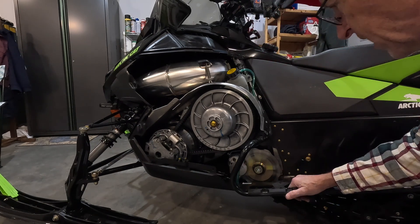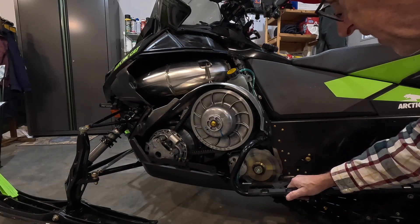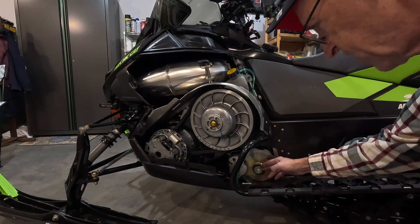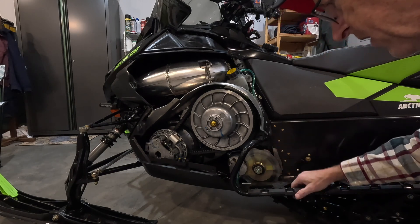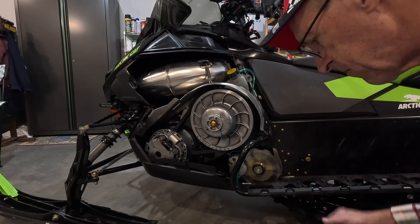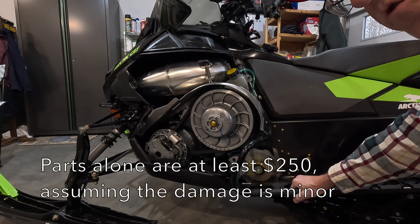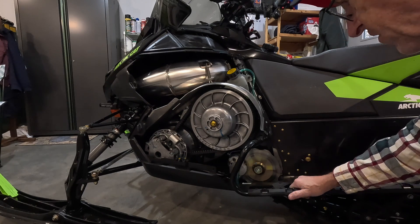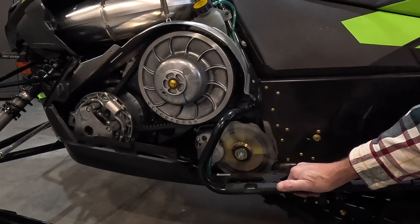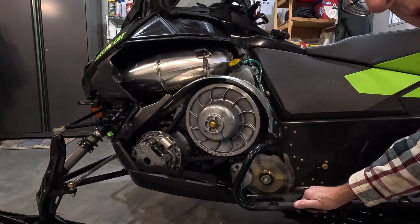Once you find damage, you're not just replacing a bearing — you're replacing the drive shaft. If this prevents damage to the bearing, which then damages the drive shaft, for $100 this can prevent probably a $500 shop bill, especially if you don't do the maintenance yourself. So it is something that's easy to do and not really that expensive when you look at the alternative of how this would impact you if you had to pay for the repairs.